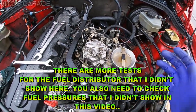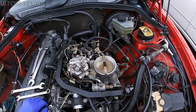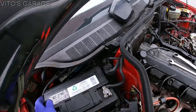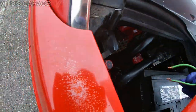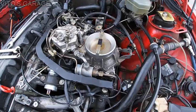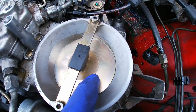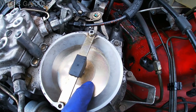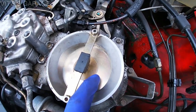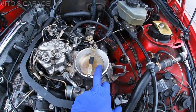We may have issues with a vacuum leak and other things causing our problems, plus this potentiometer. I'm probably going to leave this distributor in place, but I still need to pull it out, check underneath, and replace the vacuum lines and hoses. Also important: check the airflow plate — it has to have free play. If yours doesn't have play, your fuel-air mixture will be rich and your engine probably won't start. You need at least some free play on the airflow plate.